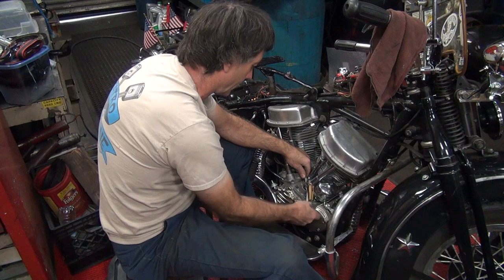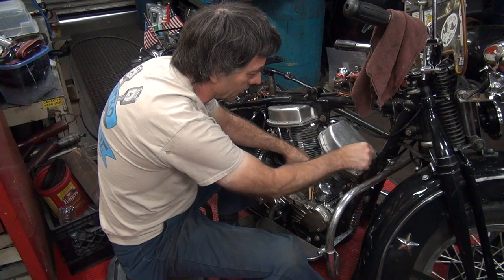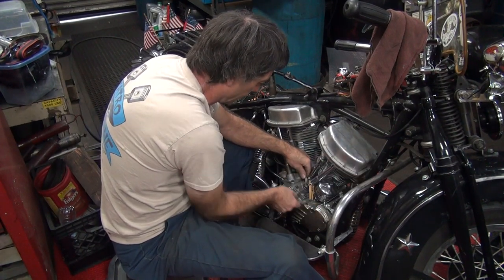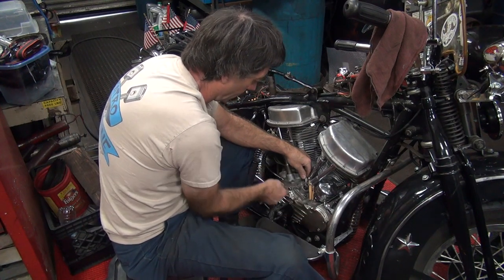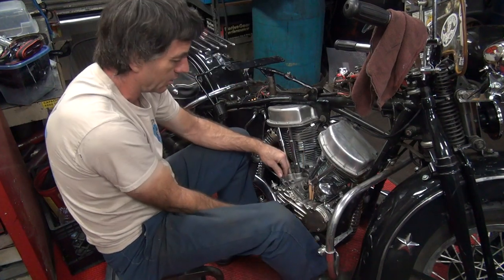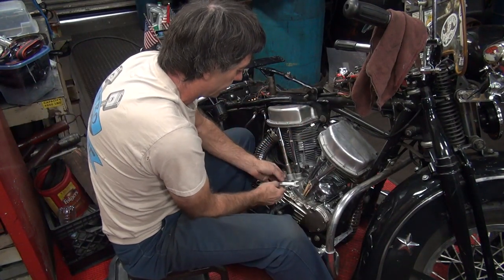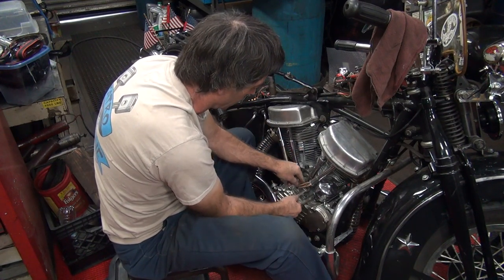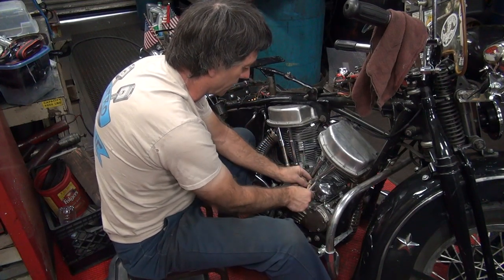If I reach around over here and see a bunch of weird stuff in the front corner, then I know it's a '48 casting. It'd be alright if it was a '49 casting — not a '49, it's '48 and '50. They're all about the same; they all break. The early ones do it quicker in the back, the later ones do it too.